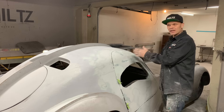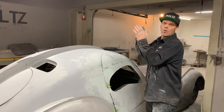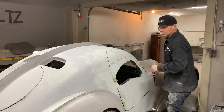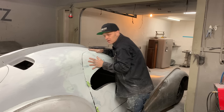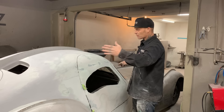The reason I flooded it is because I want it to fit the best I can. When we have water here in Nova Scotia and the water is at full tide - high tide - you do not see anything but water. When the tide goes down, that's when you see rocks and stuff that's out of place, different colors. So the metal is the ocean floor, and I have just flooded it with body fill. When I sand it down, I can stop when I see the ocean floor - and the ocean floor is the metal.